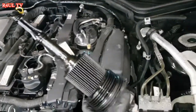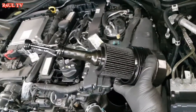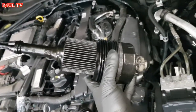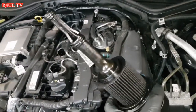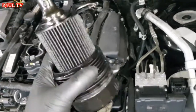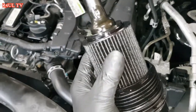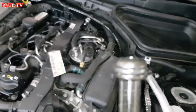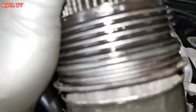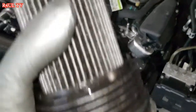The oil filter is off. The cap's still on there, there's the oil filter, there's the rest of it. My goodness, couldn't they find a bigger oil filter? Anyway, there's the filter. We're gonna tear that filter off from there — pull that off and replace it. Make sure you replace the seal as well. You can use the old seal, but you're going to get new seals with the filter — you might get three, you might get just one.